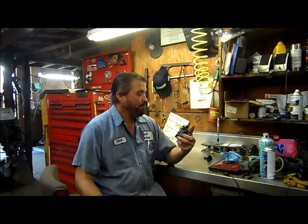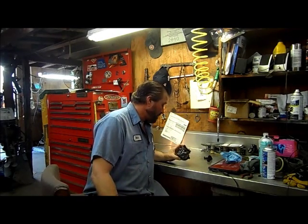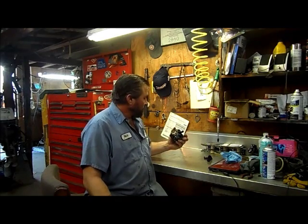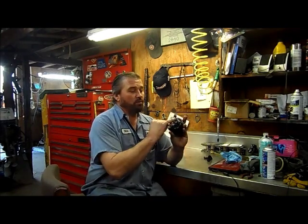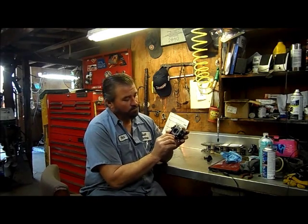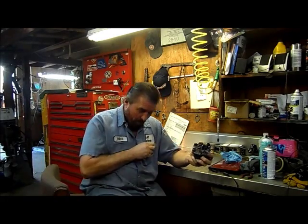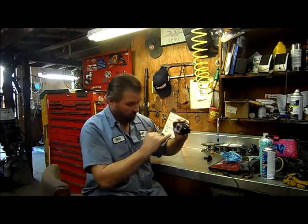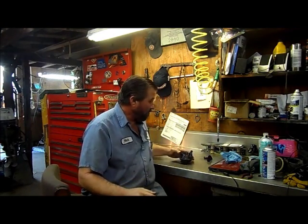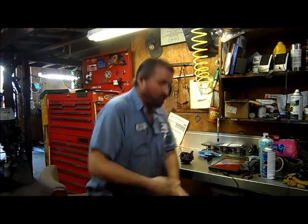The rest of the build on this is just like any other carburetor, except for a few little different variances. I'm going to need a regular and a Phillips screwdriver — that should be all the tools necessary. Now, if you'll notice, this carburetor's got a port right back here that's plugged off. This carburetor is made to operate on a couple different models. This one is a manual choke — it closes and chokes the carburetor. That little port back here is for the primer style unit; you pull it out and push in and it injects fuel behind the butterfly, giving you a little charge of fuel to initially start the motor on. I like those a little better — that motor was a little more expensive because it's a neater setup.